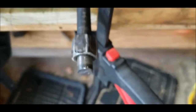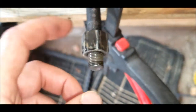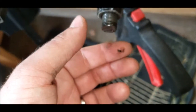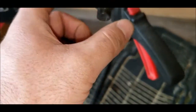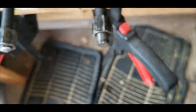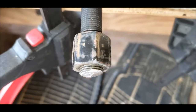And then the main one is make sure you do this with a nut already on, because you're gonna use the nut as the die cutter. So I'm gonna use my breaker bar attached here and reverse this off. When I get close, I'm just gonna rotate it back and forth slowly as I bring it off, and it's gonna clean up all the threads real nice. Basically the theory is if you can get a nut off, you can get a nut on. Whereas if you don't have one on to start with, it might be hard. So leave a nut on as you do it, and bevel the edges slightly. And that's it. I cleaned up all eight of them, and it's been pretty easy.